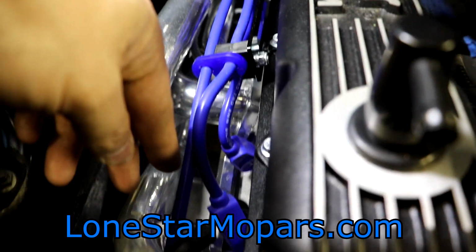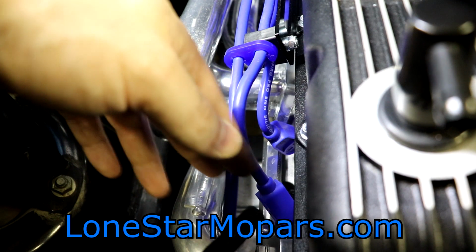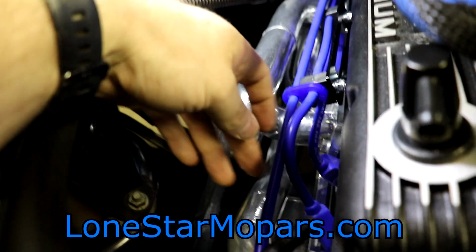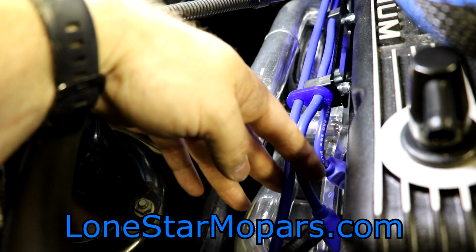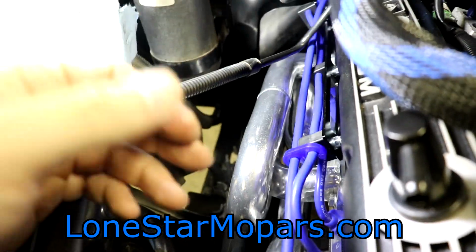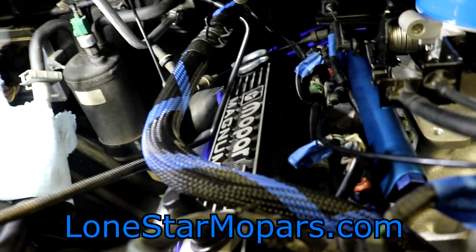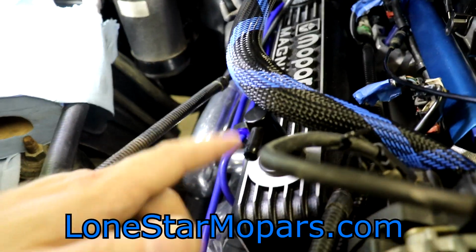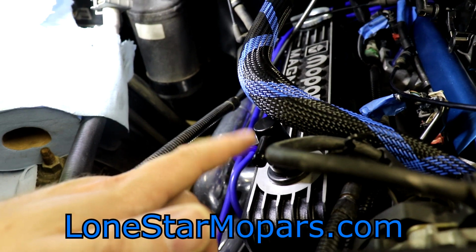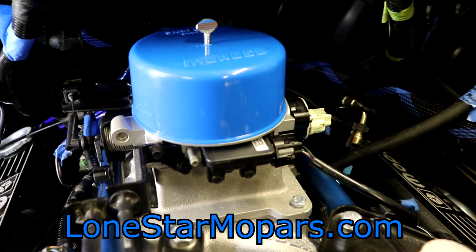If you come out here, obviously the number 2 wire is running down towards the cylinder, the spark plug, so if I want to run another one here, I can cable tie it, whatever. The main thing, it's up, so it's not as likely to fall on a primary and burn. I suppose now I should reconnect this vacuum line that I got out of here. The PCV will be dealt with at some other point in time, but it's still got a few basic things I think for this episode.